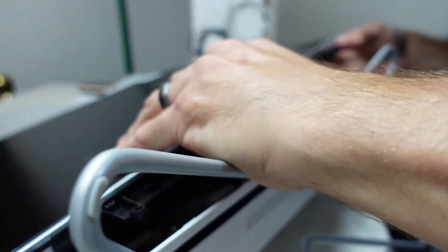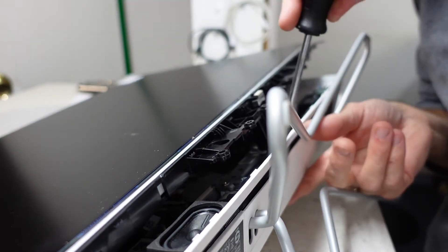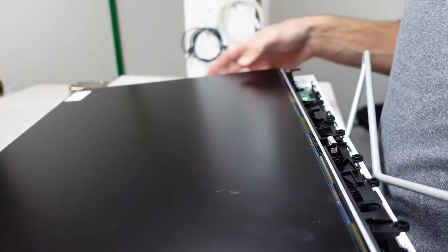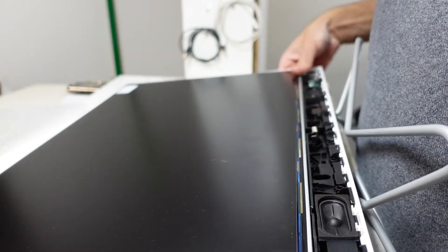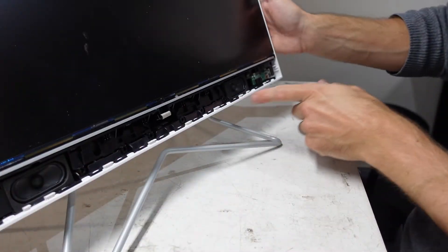I'm going to pop the screen out a little bit to get it started — let's just go flat edge screwdriver, push it up. Maybe I need to start in there first. There we go, it literally just fell back in. Massage it up the top to make sure it's in, work your way around, keep pushing, try to make it spread the force. Don't just push it in one location — that's a real risk of snapping the display.